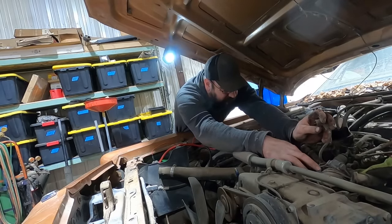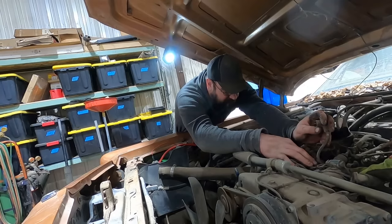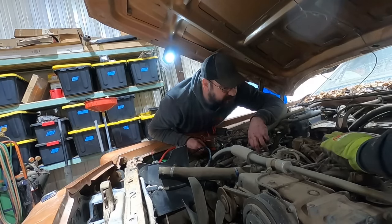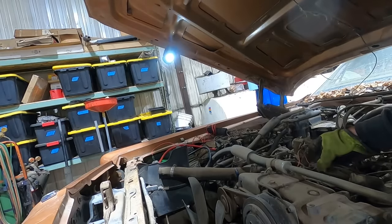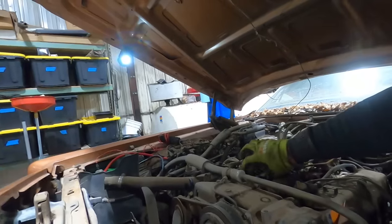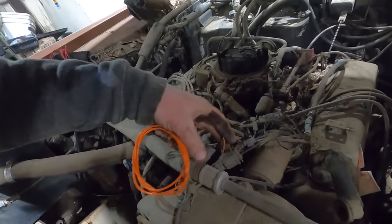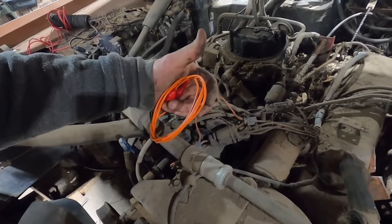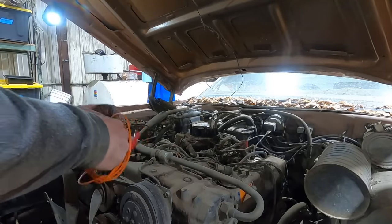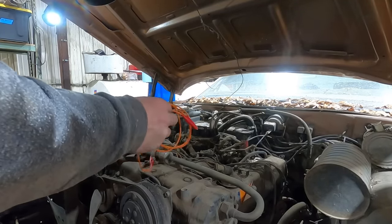This thing's from the vintage of all of the vacuum hoses. Oh, scotch clips? Yes. Oh, this plug must have been bad. So they scotch clipped it on both sides to just bypass the plug. Oh yeah, just run a new wire, jump through there. Fixed it.